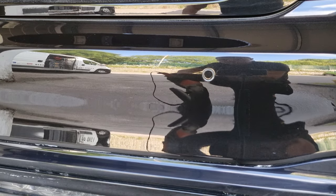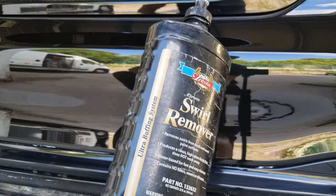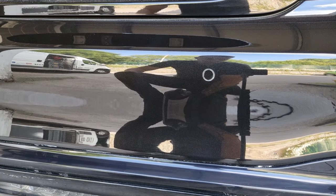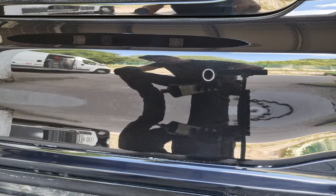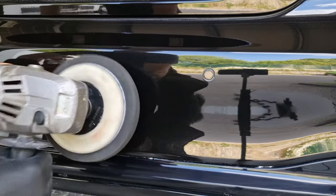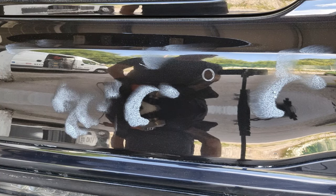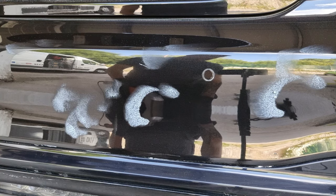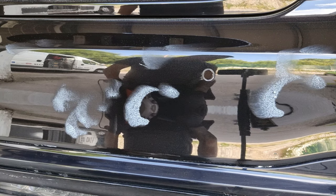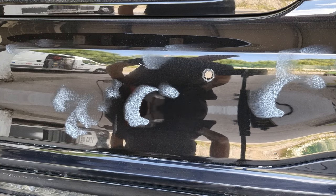Okay, so just as a finisher — it's looking really good at the minute and this is optional, you might be happy with how that is. I'm just going to use a finishing polish. I'll put some links in the description to some you can buy yourself — they come in much smaller bottles now for the DIYer. Finishing polishes spread a lot further and have a lot less cut in them but more shine, so they just add a bit of something to the finish whether it's a new or old paint job. It'll also stop any swirl marks that have been created, so it's a worthwhile part of the process — but if you don't have a finishing polish you've already got a decent finish, so you might be happy to leave it.